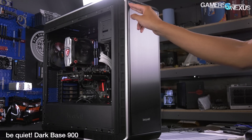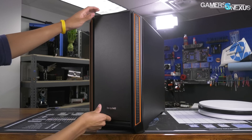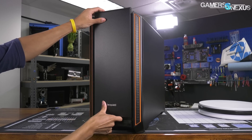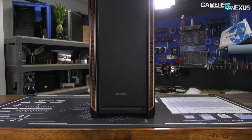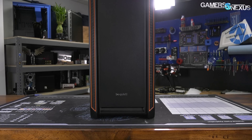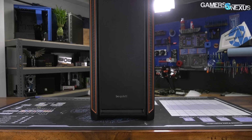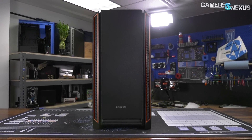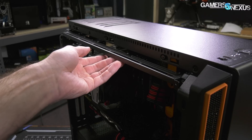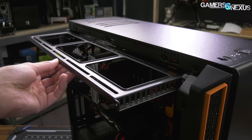It's still kind of a novelty, but it serves more of a purpose for Be Quiet than for other manufacturers because of that thick noise-damping foam. With normal side panels, it can be difficult to get the cables and foam to squeeze together enough to slide them into place, and this installation practice helps offset that. There's no magnetic front door like the one on the Dark Base 900, but the metal cover over the front filter does easily slide up and out. The bottom filter ejects from the front of the case rather than the back, which is always a welcome feature.